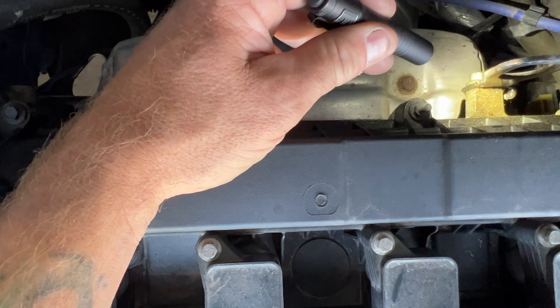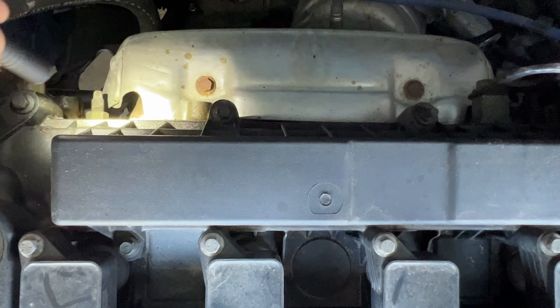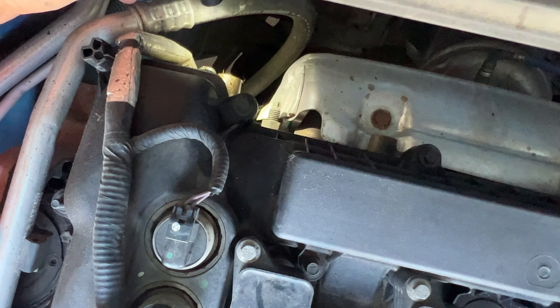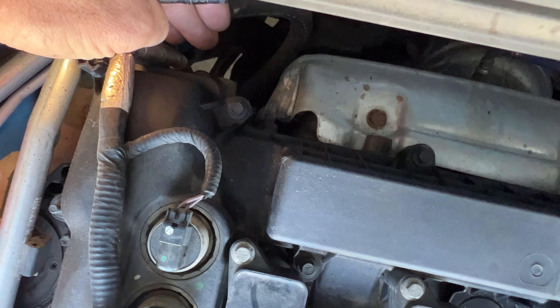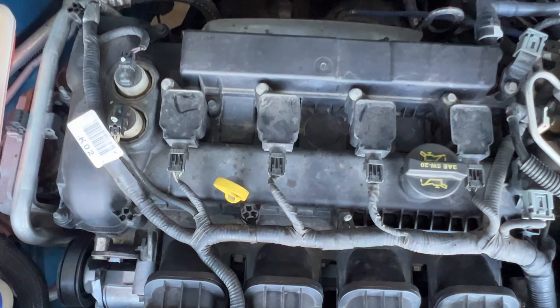You can see just how wet it is back here along the gasket surface — it's really wet right there and then back in here. What's happening is it's starting to kind of run down the backside of the motor, so I think it's time we go ahead and replace this gasket.